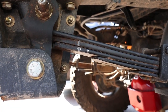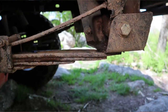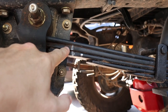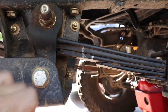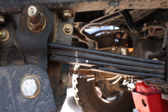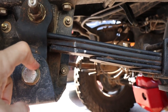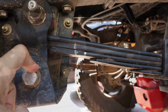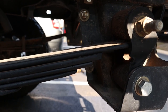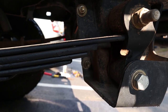Here is my passenger leaf — I have not cut it yet. You can see I went ahead and marked where I am going to cut it, because based on that picture I showed you guys, it looks like it starts to bind right here, and would get stuck under the hanger right here on the leaf where it starts to cave inward toward the end. So I'm going to cut it off there, about an inch back. Don't want to do it farther than necessary, but obviously I want to do enough so it doesn't hit next time I go off-road. I don't think I've ever had it happen on the passenger side, but driver's side a few times and it's certainly a pain. I have already done the driver's side — pretty much the same exact thing, mirror image. So hopefully zero bind next time I get off-road.